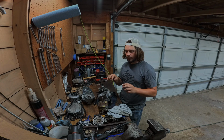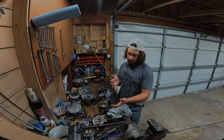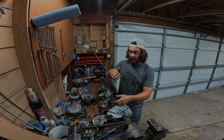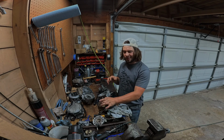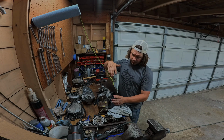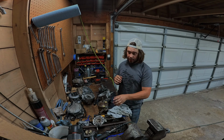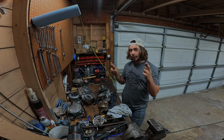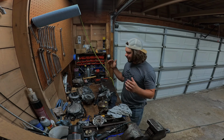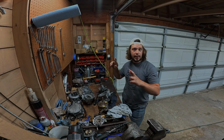And we're looking into seeing if we can press the crank pin out and just replace the rod and reuse the rest of the stuff, because I was looking at it and it's not welded like you typically see. So I'm hoping that maybe we can press this apart and replace the rod and the bearings. And we might, fingers crossed, be good with that. We gotta find someone to do it because I don't have the tools here to do it. But outside of that, we're just gonna do a lot of cleaning and waiting on parts.